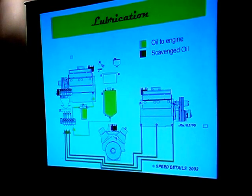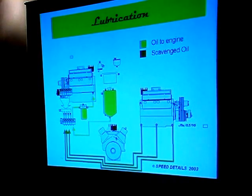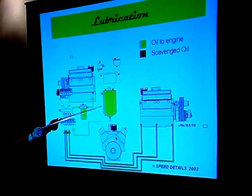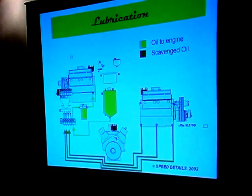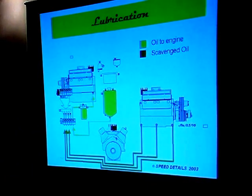On a stock car engine driving around a left-hand curve, the pickup points are on the right side of the engine primarily — you want one at the front, one at the back, and one at the middle, because of acceleration and deceleration. On a road course with mostly left turns, they might put three on the right-hand side and one on the other side. At somewhere like Le Mans, with a lot of right turns and actually only one left turn, all of this is on the other side. In more sophisticated racing engines, all of this is done internally and there's only one place where it comes out — the scavenger oil pickup circuitry is actually designed into the base plate of the crankcase bottom.